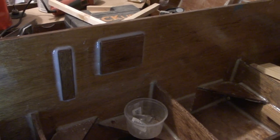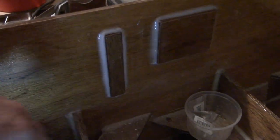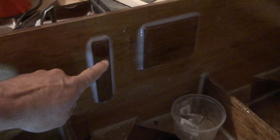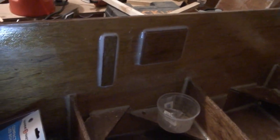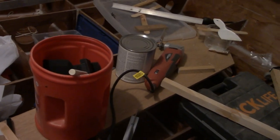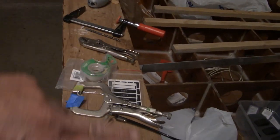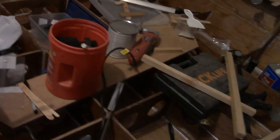Just a quick update on the electrical work: I've got my pad attached and bonded in place — that's for the fuse block. I also have a pad bonded in place for the ground bus, which is not a terminal strip but a bus strip — one solid piece that attaches right here just for the ground wires. I just have to let the epoxy fire off and get those attached. Next I'm going to be working on getting these lights installed on the bottom sides of these caps.